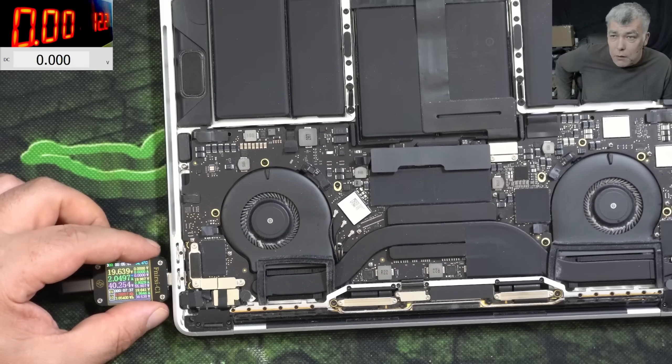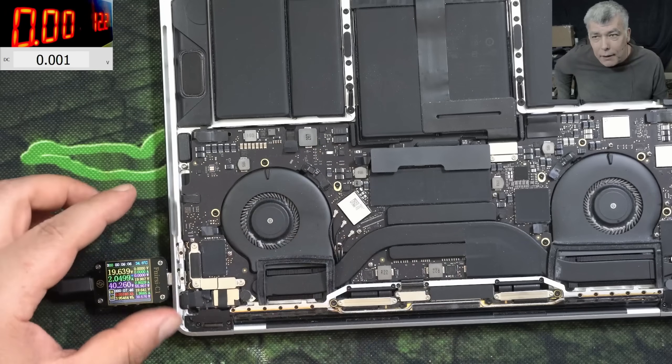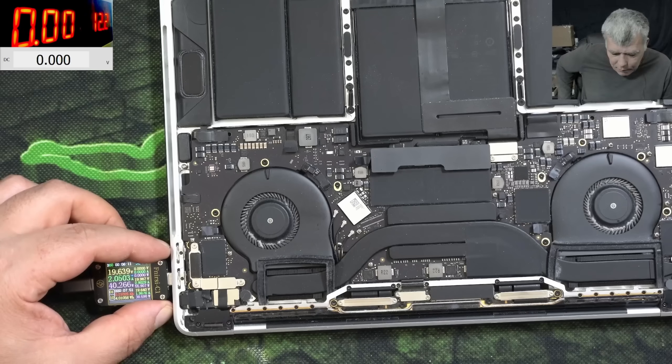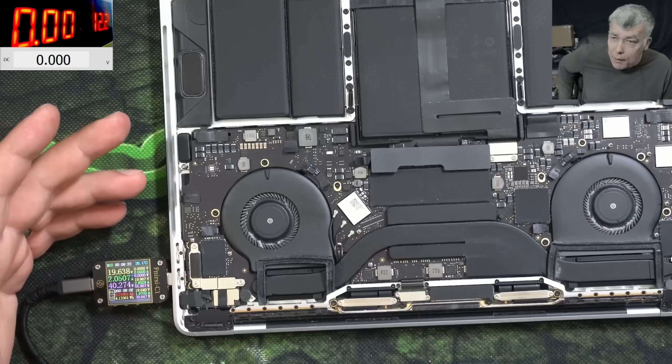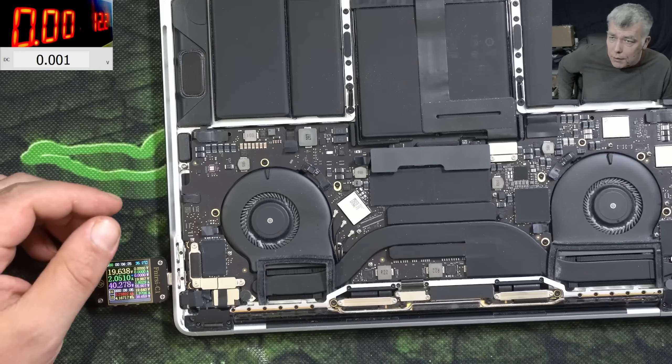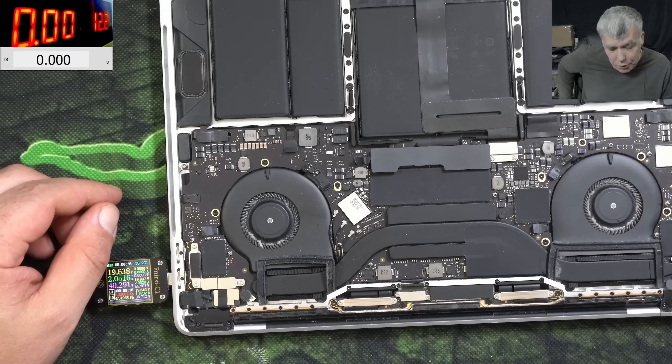What I want you to keep in mind is the diagnostic approach I followed, because there's no other way. You'll see 10 ohms and start removing every capacitor — no, I can't believe that. This is probably the only way to try to figure out the problem. Sometimes you come with a power supply, you see a capacitor getting hot. Sometimes a component is partial shorted, but as soon as you come with the power supply the short is gone. If you have another way to approach this fault, let me know in the comments.